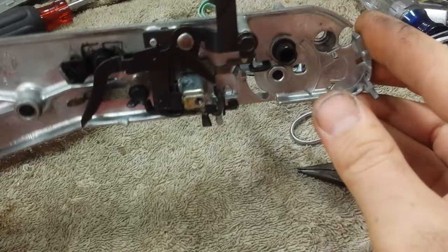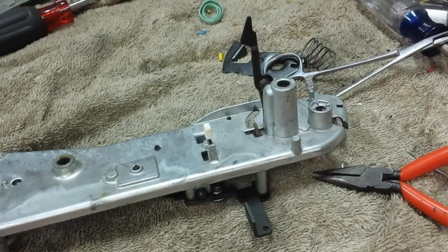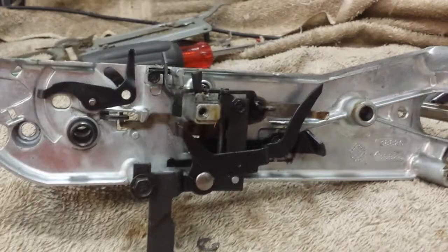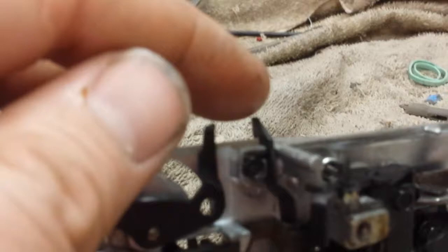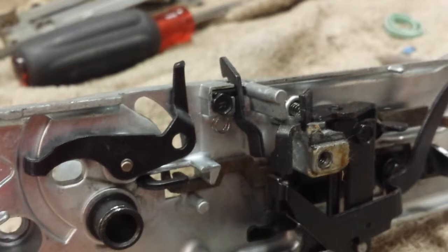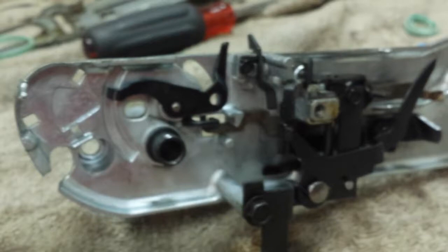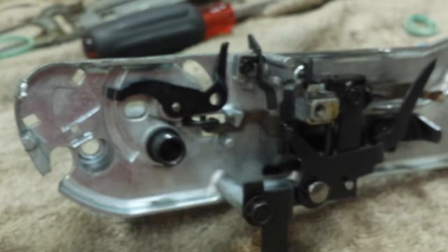If you've got one that's particularly troublesome, sometimes it's best to just gut the whole thing and do it all at once. Hope that was helpful — thanks for watching. And one more thing before we head out: I want to make note of this little part here. As you can see, it's a little bit sticky — make sure that gets cleaned too. That's part of your shut-off cycle as well. That won't completely disable it, but it will make things malfunction. Basically with this you want to clean and lube everything — anything that moves should get all the old grease cleaned out. I've already done the power switch, and then we'll do all the rest: all the record feelers, selector switch stuff. Just wanted to include that last note because it's important. Thanks for watching — more stuff to come soon.